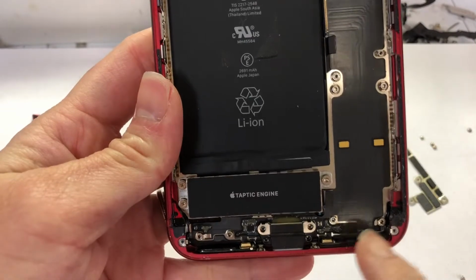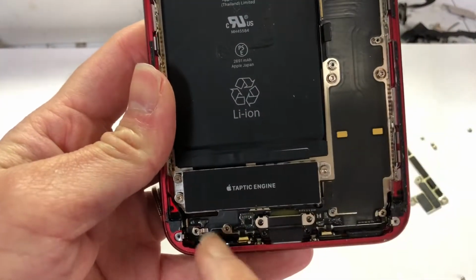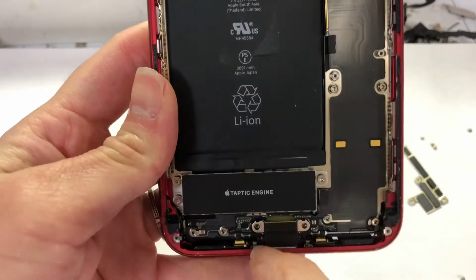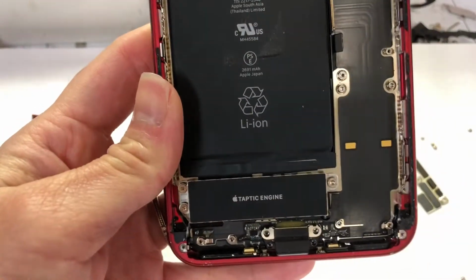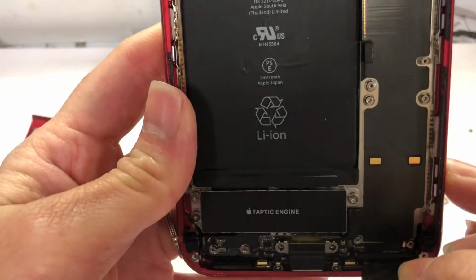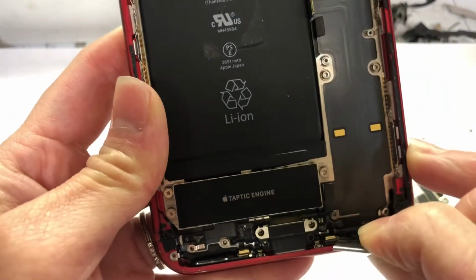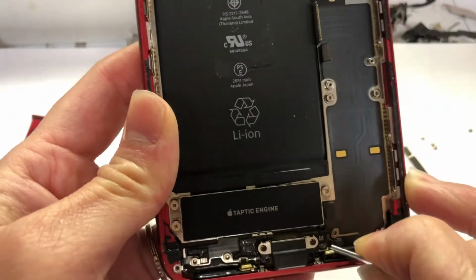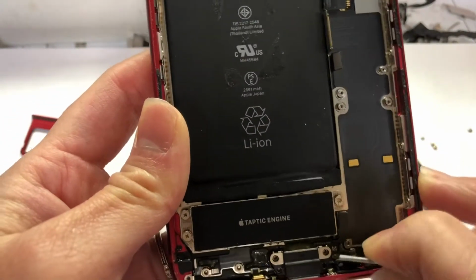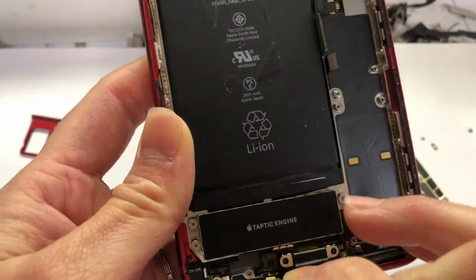and then I heat up a little bit to melt the glue of the charging board so I can take it off easier. You can use the razor right here to separate these two first. Right here. The earphone right here. Two mics. Have two mics.